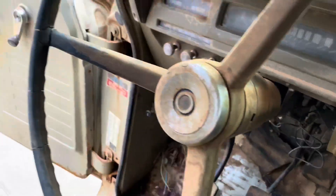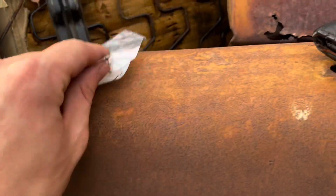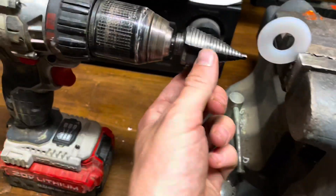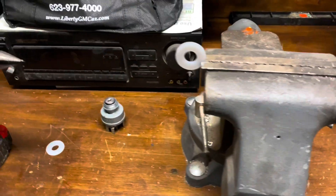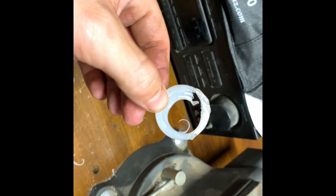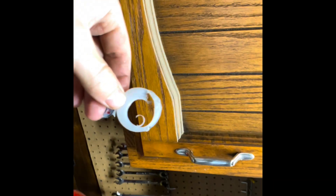Let's hop in here and show you what I'm doing. When you put the new ignition in and tighten down the little nut, it spun. So what I'm gonna have to do — let's get out of here because it's like 160 degrees in there — I'm gonna have to bore out one of these little nylon washers to give it a spacer so it has something to tighten down against. First attempt did not work out very well, so I dug around in my old parts.